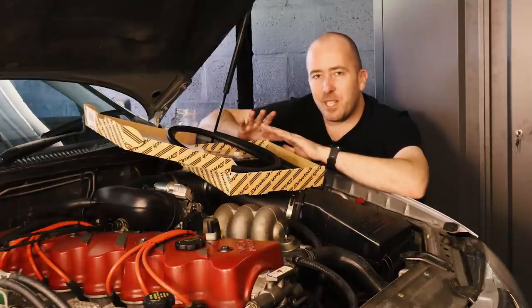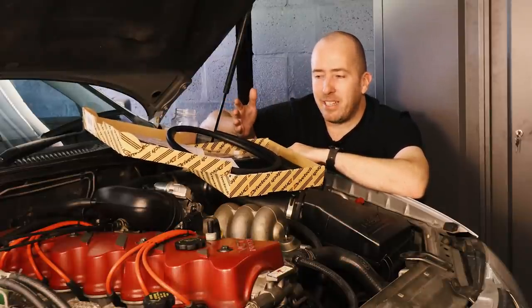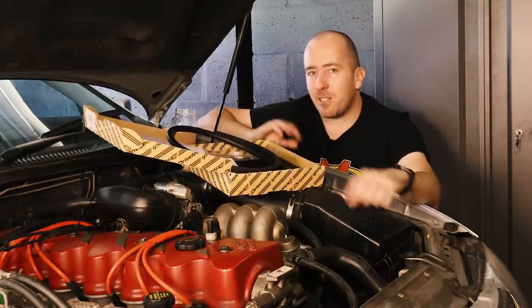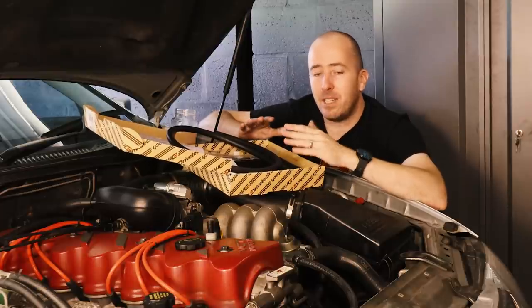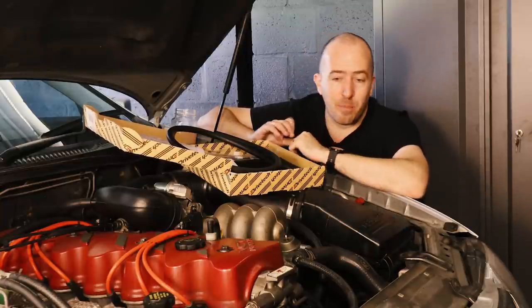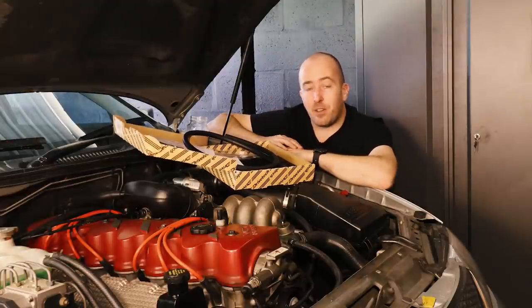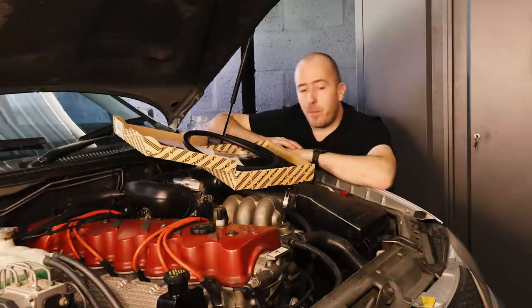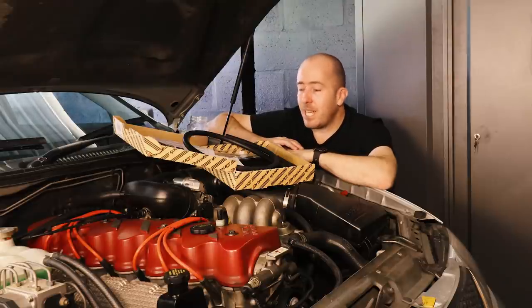But one thing I'd like to consider here before we continue is this kit, right? It costs $200-something to buy. That's actually not a lot less than a brand new radiator. So really, if you want to err on the side of caution, you can go this route, but almost equally as good would be just replacing the entire radiator in the front of your car. That's going to mitigate the issue. So yeah, there's really two ways you can go about it. This is obviously an expensive proposition, not a lot less than an entire new radiator. So both ways are going to fix the problem, but arguably having a standalone cooler like this one is going to do a better job. So that was my logic. That's what we're going to do today. Come along for the ride. We'll see how it goes.